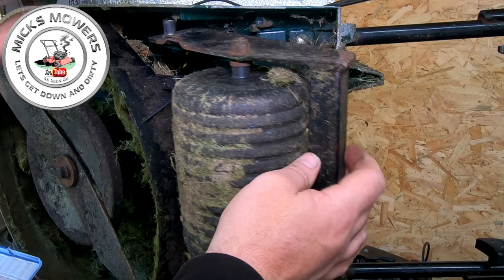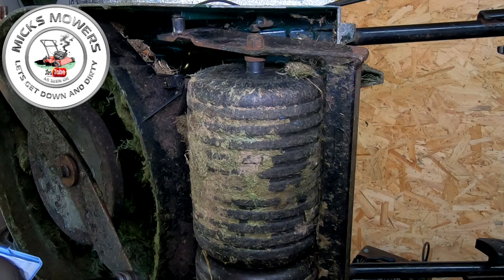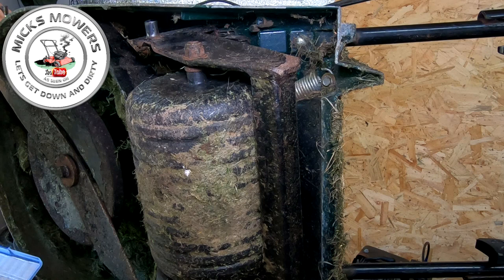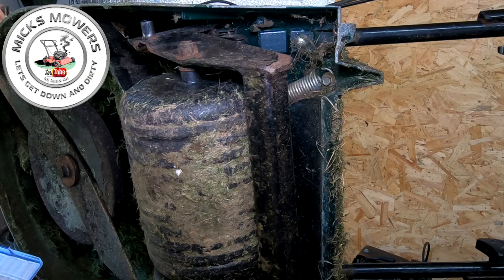And I've got these little tiny plates that I took off earlier on, off the bottom, yeah? I'm just going to gently screw one of them back into place. Once that's in place, that will hold it to a degree. I've got another 10mm to put in as well, which should be that one. And lots of people have said before they tried doing these and they're really hard to do. If you do it this way, actually taking the roller out, just makes life a bit easier.